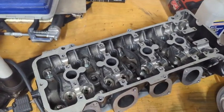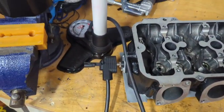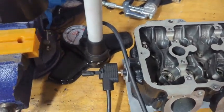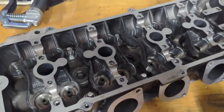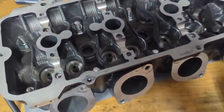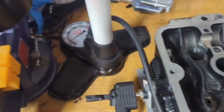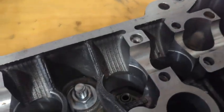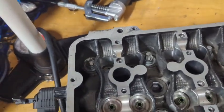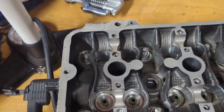Now that you have the plates on and everything is sealed up, put the pump onto it. This one has a pressure gauge built in. Pump it up — this works better in a quiet environment; you can sometimes hear the hiss as you pump it up. I pressure it to around 30 to 40 PSI. If you listen closely, you can sometimes hear a hiss. To check, use water — I originally used isopropyl alcohol but found it got onto the adhesive on the tape and turned it into a goopy mess.